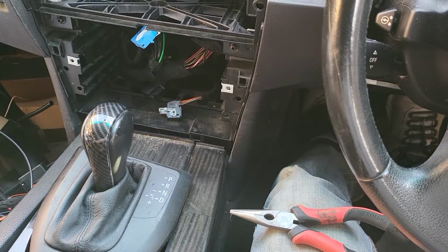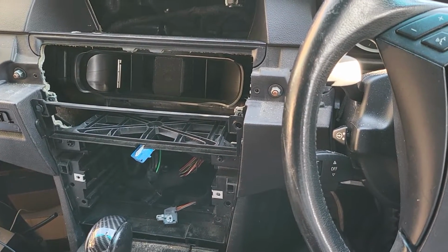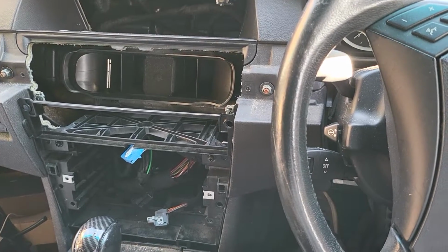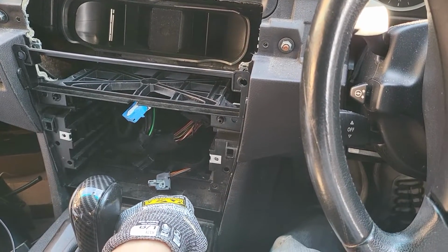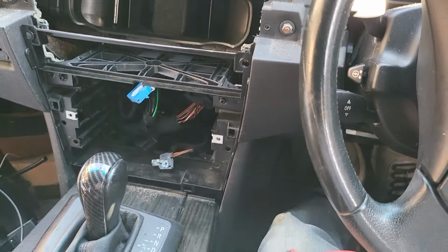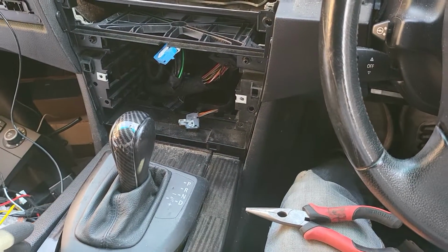The reason why we want to do this is because, as many of you doing the head unit upgrade might want to get something with the power source from the accessories, and that is one way to get the power for accessories. The cigarette lighter will have the 12 volt on ignition, so that's a good point to have the power like that. So back to the video now.